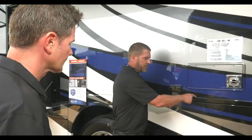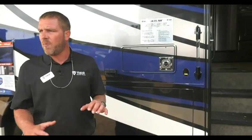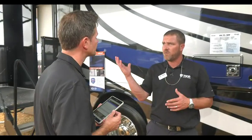The main purpose of that in an RV is you're not going to get stress cracks off the belt line. If you put a paint that hardens on a 38-foot motorhome that's flexing, you're going to get stress cracks like we've seen in the past. But Sikkens paint is the best automotive paint in the world, simply put. Nice. And we'll walk up through here.